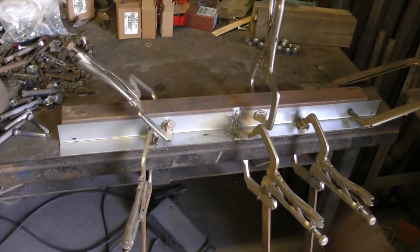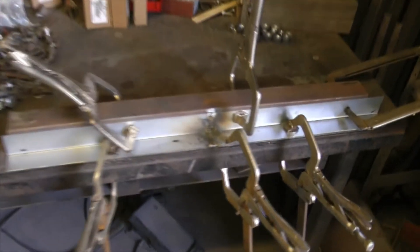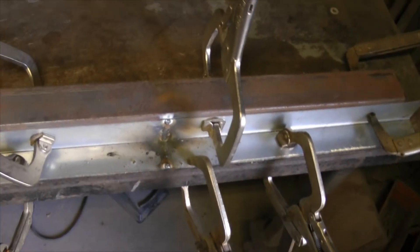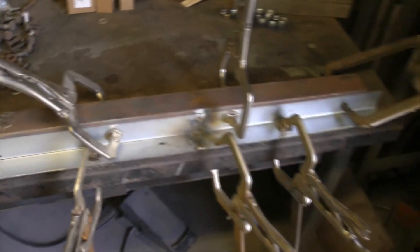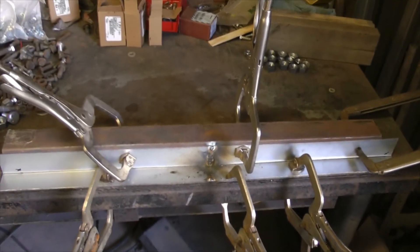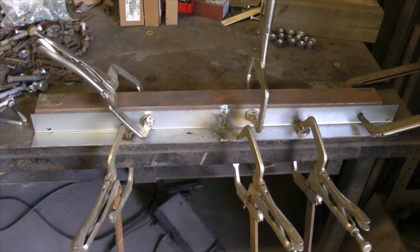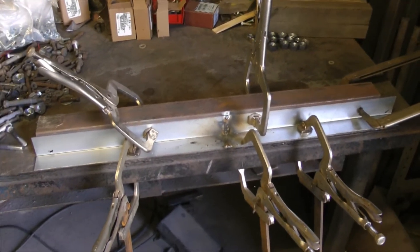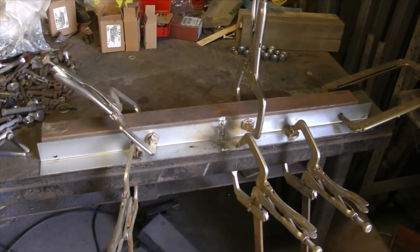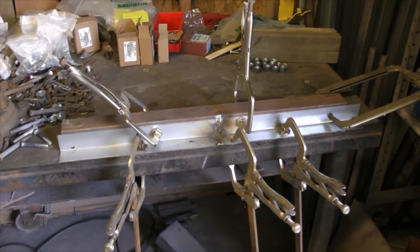Fabricating the pieces for the core support, I needed to bend a piece of 16 gauge — that piece is 30 inches long and my brake won't bend 16 gauge metal that long. So what I did was cut it in half, bend it in two sections, and use my table and a piece of square tubing as a fixture, then welded it back together. Some of you eagle eyes will notice I'm using galvanized for a couple reasons: I was out of regular 16 gauge, and with the price of steel nowadays it didn't make sense to buy more when I had this galvanized sitting here. Plus, galvanized for the bottom of that core support is perfect anyway — I just have to be careful welding because galvanized puts off toxic fumes.